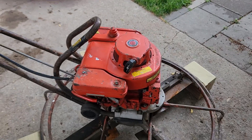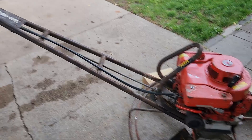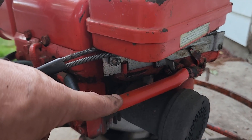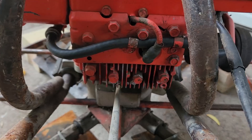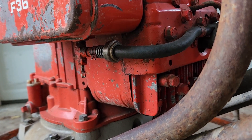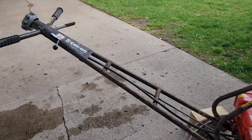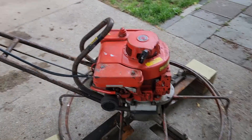Some non-ethanol gas and some Sea Foam just to clean it up - the smoking finally stopped. I put new fuel line on it as well. The fuel line off the carburetor here has this metal heat shield because the muffler is right there, wraps around this side of the engine, and then connects to the fuel valve there. There it is - something I'm never going to use, but now it's running for the guy who will use it. All right, thanks for watching.